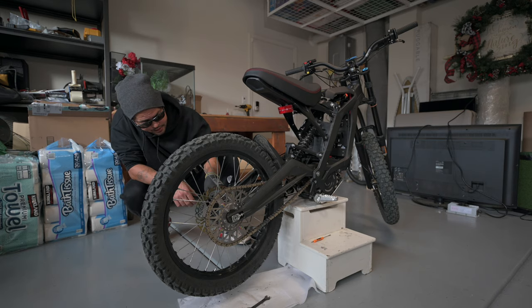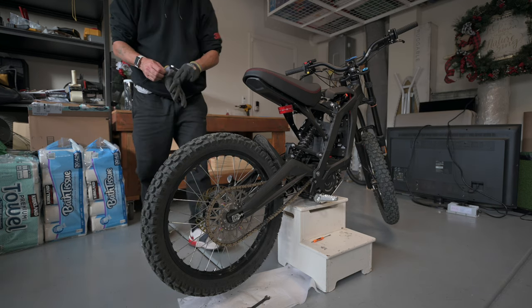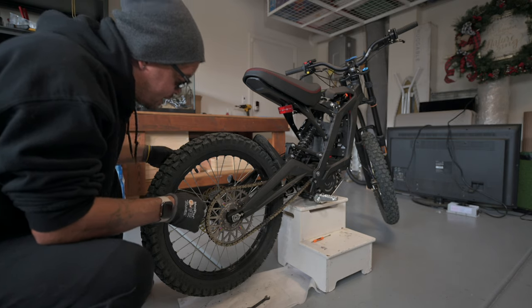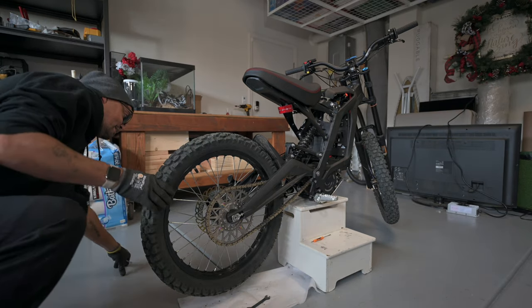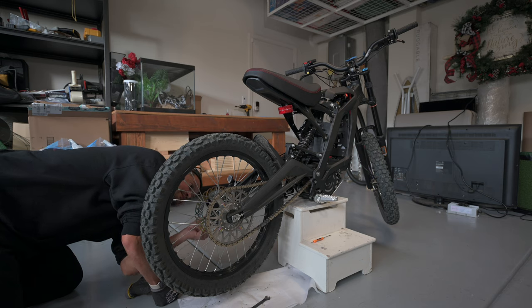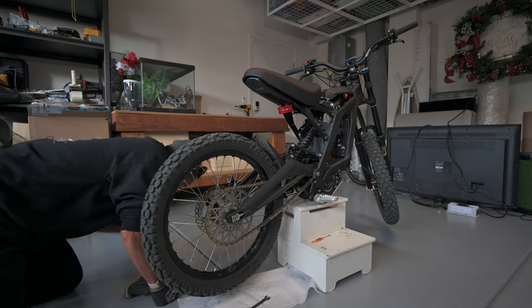We're almost touching this side now. Okay, now that we have both sides touching our alignment block, or whatever this thing is called here, what we are going to do is try to get them aligned. Now this side here is back pretty far. If I'm going to look at it, I'm going to say it's between the second and the third notch.